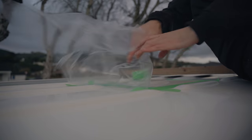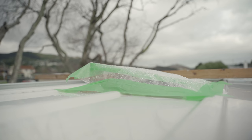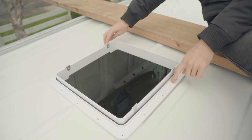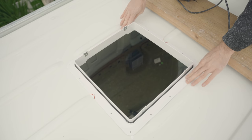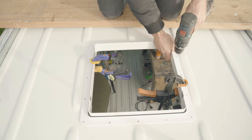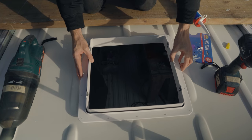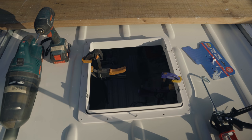With the rain rolling back in I called it quits for the day. The next morning I got to work filing the edges smooth and sealing with primer. Once dry, the collar went on — it needed a little notching to fit over the ribs snugly. I clamped the wooden frame and collar together in their final position, starting holes with a self-centering drill bit before fully drilling through the steel of the roof and into the wooden frame, then screwing it all down together clamping the roof between the collar and the wood frame.